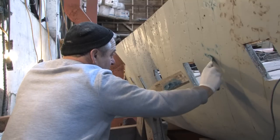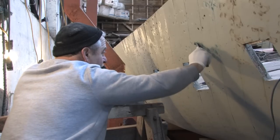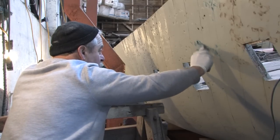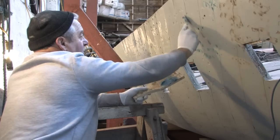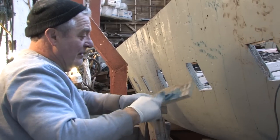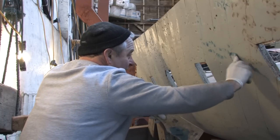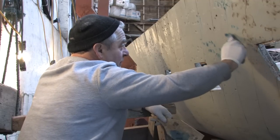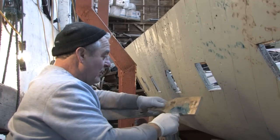This is quite nice stuff. It's blue at the minute, but once the hardener starts working on it, it goes like a grey colour. What you try to do is plan your day out with your filler. The longer it's dried before you sand it, the better it is and the easier it is. So you try to make sure you've got enough filler done one day so you can come in the next day and it's hard.